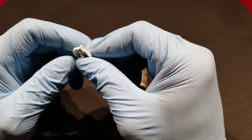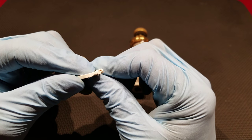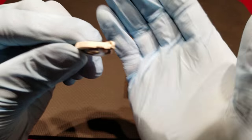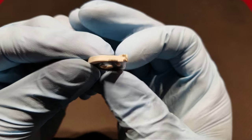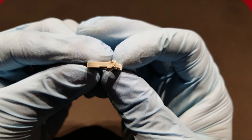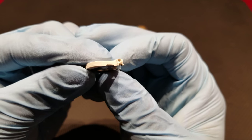Some other issues that you'll run into with these valve guides is that over time they'll get kind of chewed up. You'll notice this one is kind of chewed up here. With a repair like this, the easiest thing to do is to change out the valve guide.